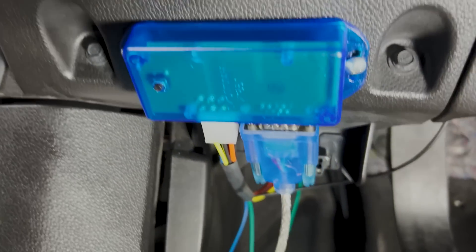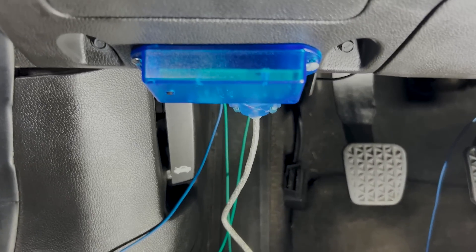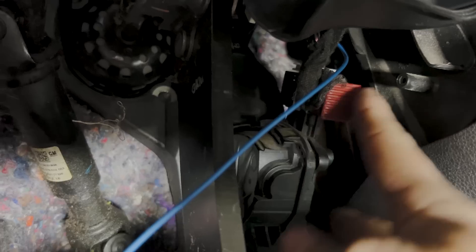This is where I ended up mounting the White Box, just right below the fuse box. The cable's not very long — even sitting in the driver's seat it's hard to plug a laptop in, but it's close enough and I'm able to visually see the blue blinking light. Let me show you how this is wired up. We have our ground coming up here — I still need to put the little eyelet in it. And over here is your throttle pedal — you just pull this little red clip out and here's the connector.